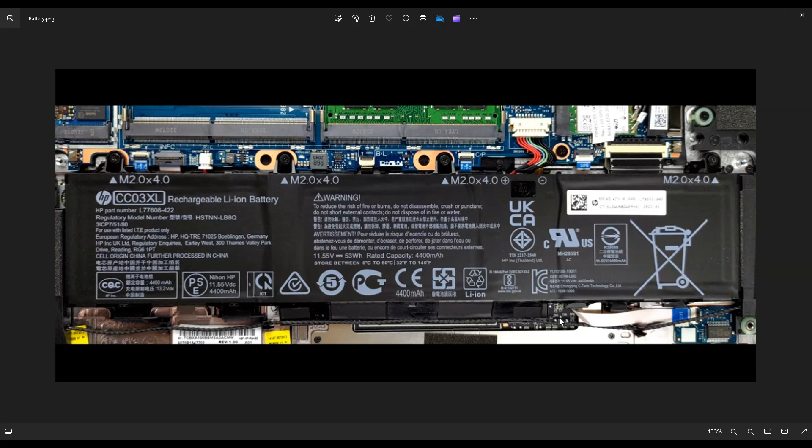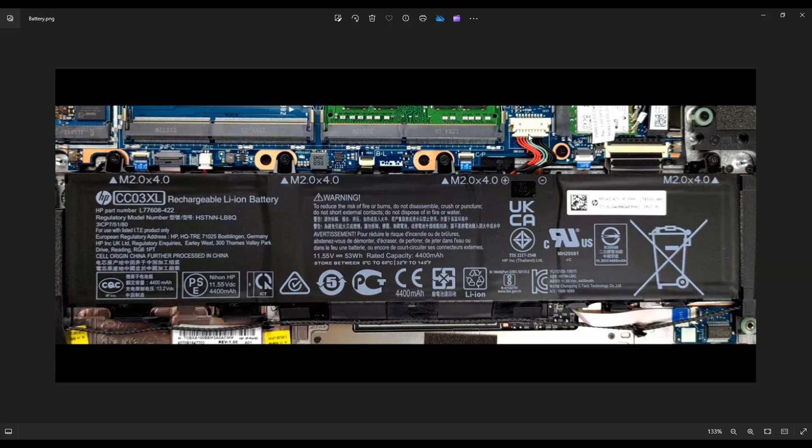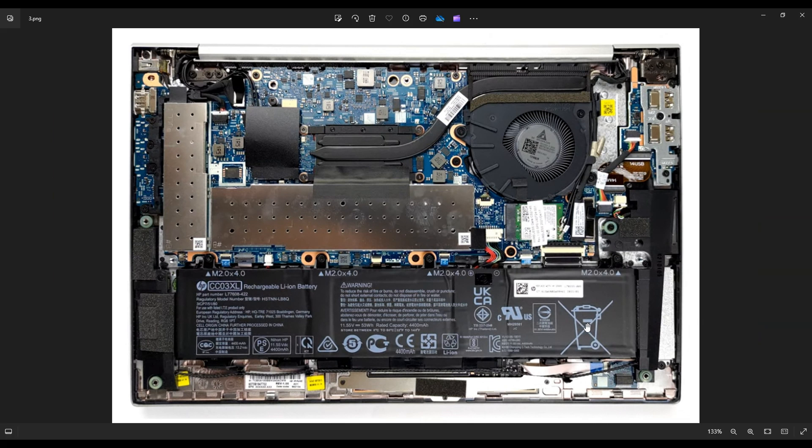In order to get the battery out, you also have to take the speaker wire here. See how the speaker wire goes along the bottom of the battery? That's kind of stuck in there, so you've got to make sure the speaker wire is not connected to the battery before you rip that battery out — you could damage your speakers. This is your battery plug right there. Some of you may have a black piece of tape over it; you may have to bend that back a little bit. After the tape is removed, you can unplug this. As with any wires in a computer, try not to pull on the wires — use your fingernails on the plug, or a pry tool, or pliers. And you can just jimmy that plug right out of that port. After your battery is at least unplugged, we're safe to proceed deeper into the computer.